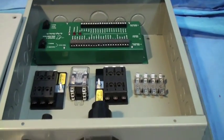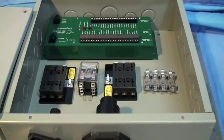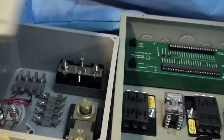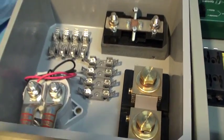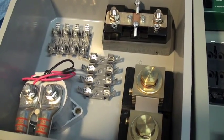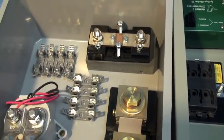The reason I've separated this is if you look in the Zilla manual, it actually recommends that you have a foot of space in between your high voltage and low voltage. So over here, this will be my high voltage. I actually have my contactor here and there'll be a variety of fuses that will have my amp meters and volt meters connected to my shunts.